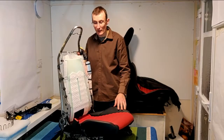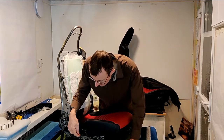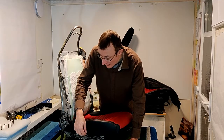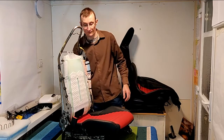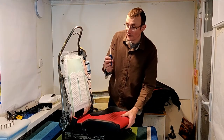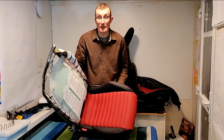The first thing we're going to do is release the seatbelt cable, because it's through the side of the seat cover, and we don't want to tear the seat cover, and when we try and take it off, it won't come off cleanly unless we remove that. Now there's a multi-plug just under the front here, and we're going to use our flat blade screwdriver and just remove it and then slide out the seatbelt wire.